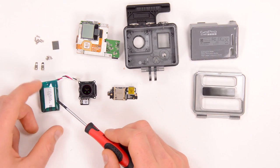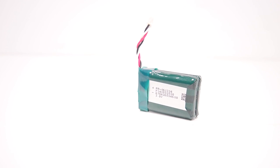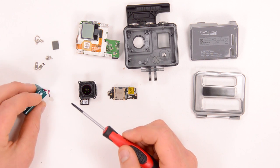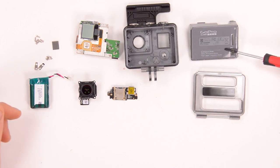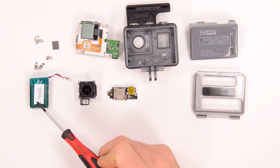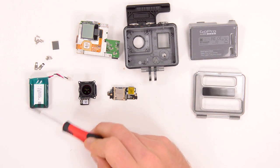And finally, there's the battery. This is a 3.8 volt, presumably lithium polymer — I can't read much of the information on the back of it — lithium ion rechargeable battery, 3.8 volts with a 1130 milliamp hour capacity. This one is detachable and it's very easy to access, so I would presume this would almost be user replaceable. Getting this back door off the camera is really easy — it just involves pressing on the side to pop it out. Kind of like smartphone batteries, if one day it stops holding a charge really well, you could probably replace it without too much trouble.